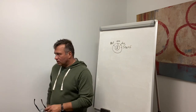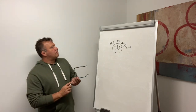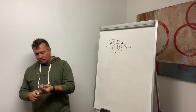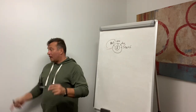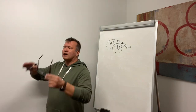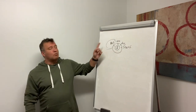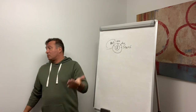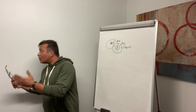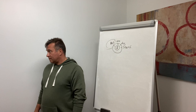Guys, in the school, until you get your license, please avoid putting the key in the battery position. Even though I will explain it, I will keep explaining it. When we go in the yard and we work on the truck, I will say it every single morning, every single time we start our class, guys, avoid leaving it in battery position. Why? Tell me, why? It's drawing battery. Okay?